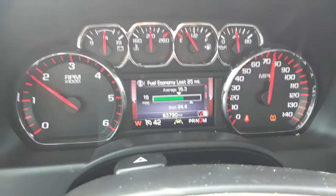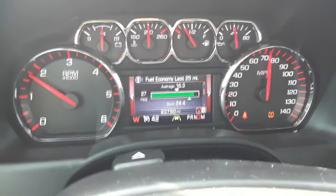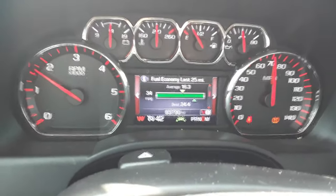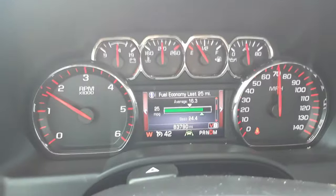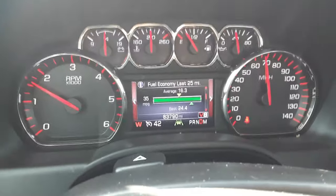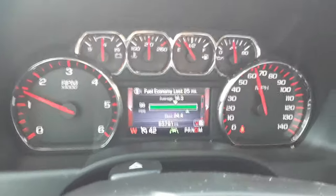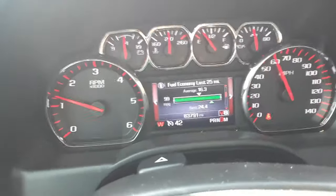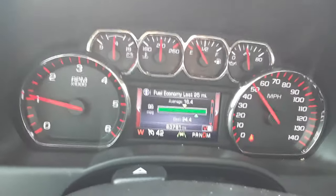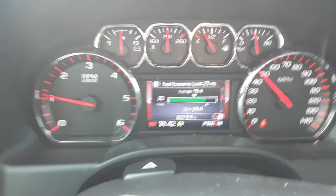The shifting issue was a lot more intermittent than the shuddering. The shuddering was always there. So that's completely gone. So the transmission change definitely fixed that. And also, I just wanted to tell you that I reused the transmission gasket, and there is absolutely zero leaks. So don't be afraid to reuse the transmission gasket. Just make sure that you take a look at it. Make sure that it's still nice and pliable and that it's still raised up where it's supposed to be and it's not smashed down when you take it off.